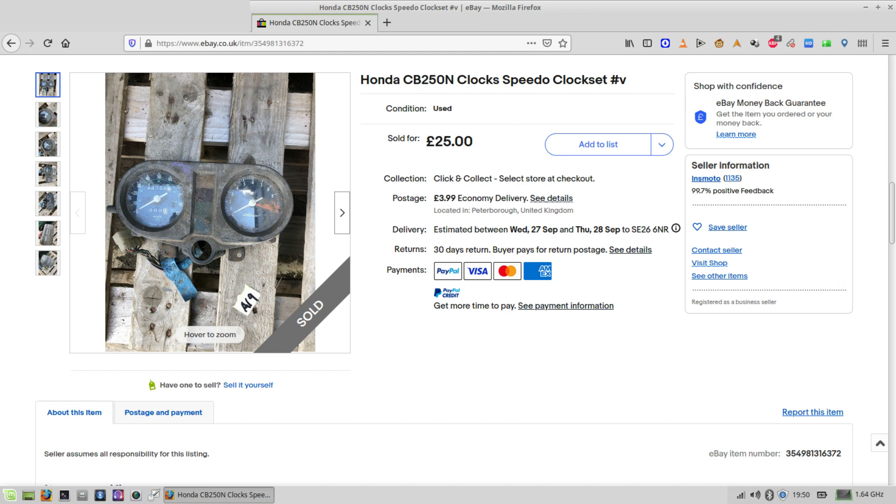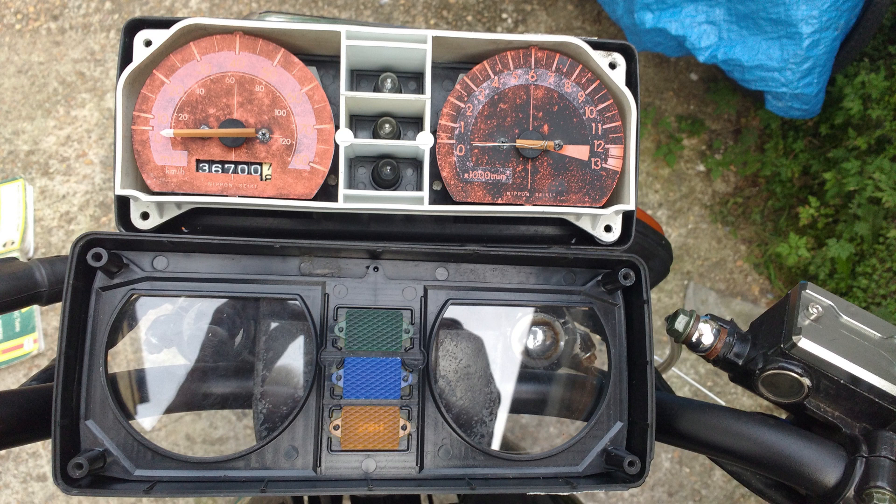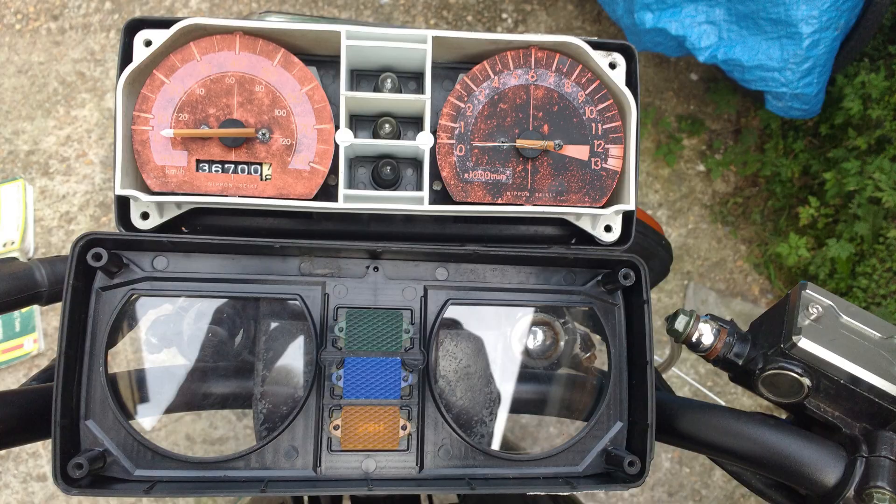As you can see in this picture, this is what I got. I knew it wasn't necessarily going to be straightforward to replace the gauges from the 250 into the 125's gauge cluster, but I did know that the drive system should be identical, or looked identical. I tested this once it arrived — attached a spare speedo cable to each gauge in turn, spun it with a drill, and yes, it worked. So I was fairly confident that the cables would be fine going from the 125 into the 250's gauge cluster.